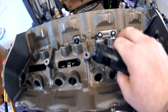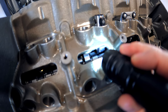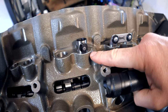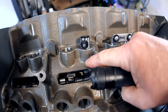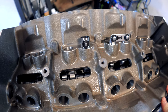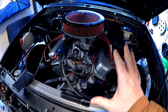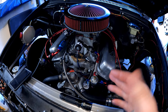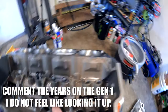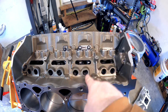With the shorter lifter, it's hitting the cam. Looking over here with the taller lifter, it's not even on the cam yet — that's not good. You can see right here why it is hitting: this is the deck of the lifter bore, and it's taller. That's why you have to run a 300 thousandths taller lifter if you're going to a link bar setup. The same goes for an LT1 and OE roller blocks in small block Chevys that had the spider assembly — they all had tall lifter bores.